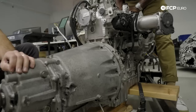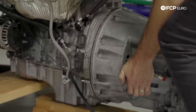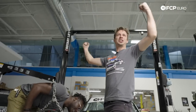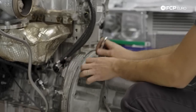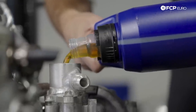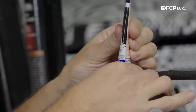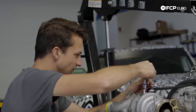That's the closest it's ever been there. It was finally time to lubricate the engine. Taking a page from our IMSA GT4 team, Liqui-Moly's Leichtlauf 5W-40 was the oil of choice for the engine, while the turbocharger received some ProLine turbo additive to keep all the bearings lubricated during initial startup.